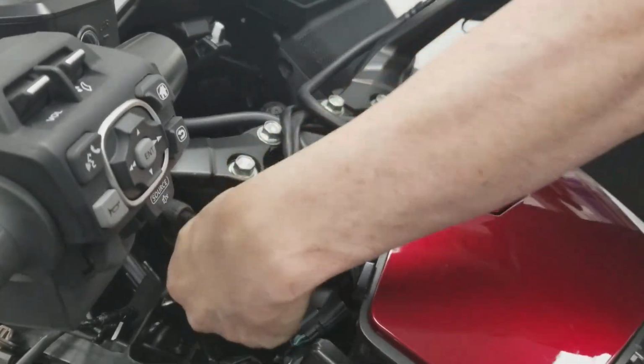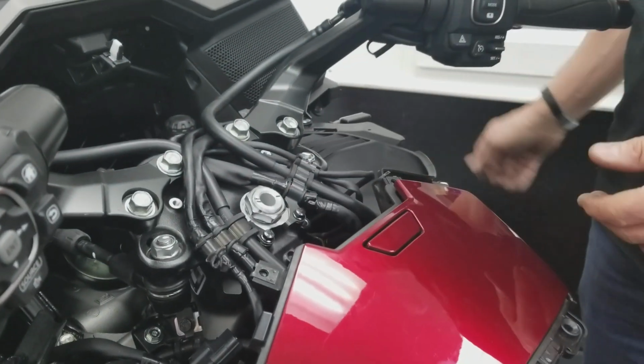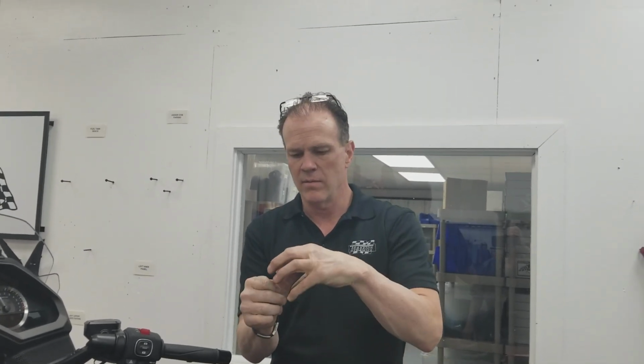Anyway, so drop the tie rod, and then you can lift the whole crown and handlebars off. It exposes what looks like a traditional steering stem poking through with a normal set of Honda steering bearing adjusting crown nuts, castle nuts there, with a traditional tabbed lock washer that secures the two, everything you've seen before in the past. What's new and improved that you will be surprised by is that because there's no lower triple clamp that the spindle is attached to, it just turns forever, 360 degrees.